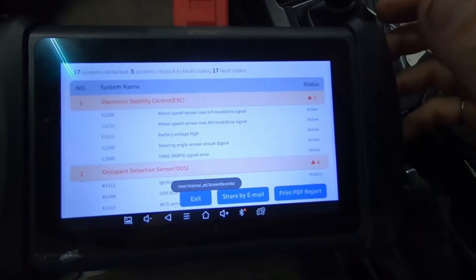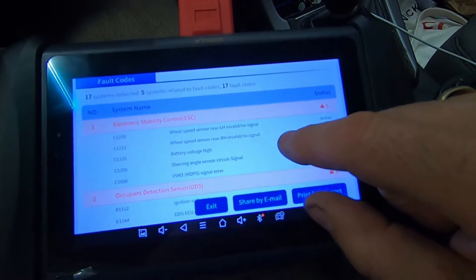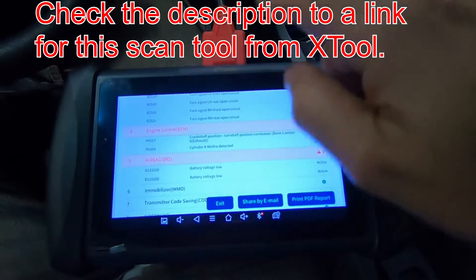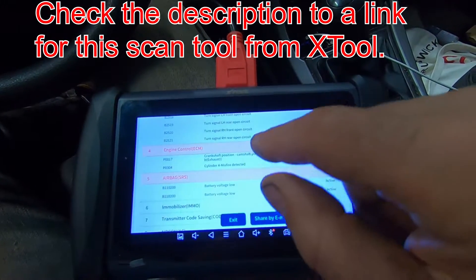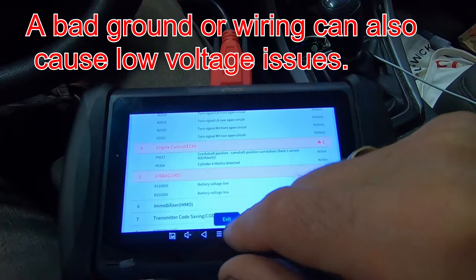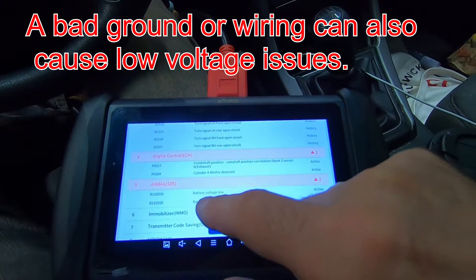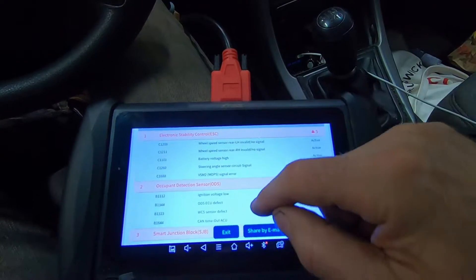Let's hook the scanner up and I'll show you what's happening. I went through a full system scan and was surprised to see there were actually codes set — ECM codes and airbag codes. There was a voltage low code for the airbag. Whenever you see anything with a voltage low code, clear it, and if the code goes away, generally it's because your battery was too low at one point. I know this vehicle had been sitting for weeks, so I guessed the battery had just drained down over time, and I cleared the codes.